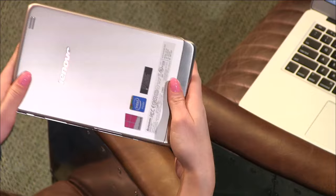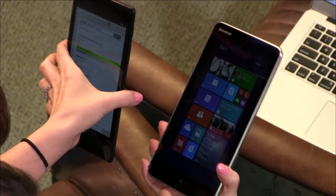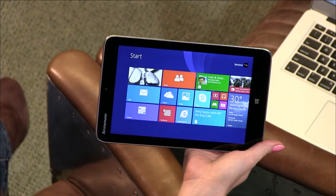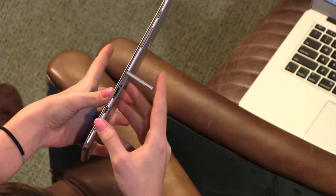As far as form factor goes, it's really nice — very little, very lightweight. I can hold it with one hand. Compared to the Nexus 7, a 7-inch tablet, it's very similar in size. This one weighs just 12 ounces. It's got a full operating system — Windows 8.1. It has 32 gigs of storage space, 2 gigs of RAM, and an Intel Atom Bay Trail quad-core processor. Bay Trails are the ones we were waiting for. It also has a micro SD card slot on the side with a flap right next to the micro USB charger port. Volume and power are at the top.